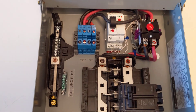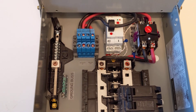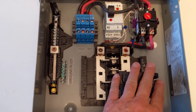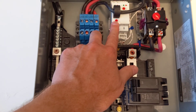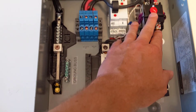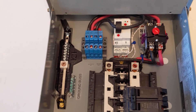How this works is just like the Dryer Buddy Plus Auto. This is the master. When that circuit is in use, this is turned off, and when the appliance draws less than 2 amps — which is actually adjustable, but we found that's a good setting — then this will get reactivated, but not right away.